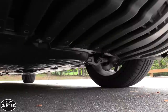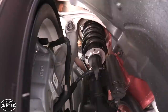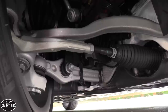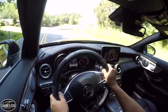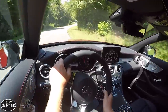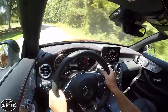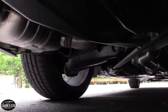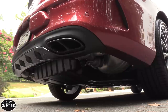Underneath is an independent aluminum-intensive four-wheel multi-link suspension — four-link in front, five-link in the rear — and there are three-mode adaptive dampers, so you can soften or stiffen them at your discretion. Like the C63, the C43 has a unique AMG front suspension design with stiffer steering knuckles, improved elastokinematics, increased negative camber, newly developed wishbone guide bearings, and more. The end result is a car that feels sharper and more agile, delivering greater suspension feedback so you feel more connected with what you're doing. Despite being firmer than a standard C-Class, it's by no means uncomfortable — it's still pretty well-mannered for a daily driver.